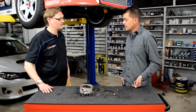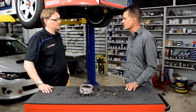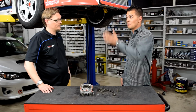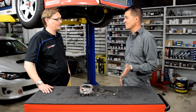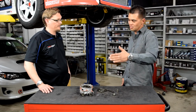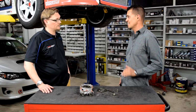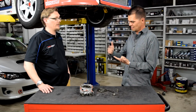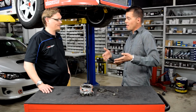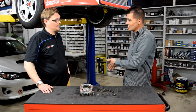I'm going up Pikes Peak, and we're seeing temperatures that I've never seen anywhere else, and I'm noticing the pressure's dropping, and the oil temperature is actually a lot hotter. Interesting. Let's go through and try out different weights. Let's try out different vendors' oils. I certainly have a different respect now for saying I use this oil and this is exactly why I use this oil, not because I just read on the internet that it's a good oil. From my observations, these gauges have shown me this change, and I'm going to stick with this oil.